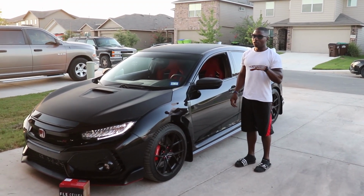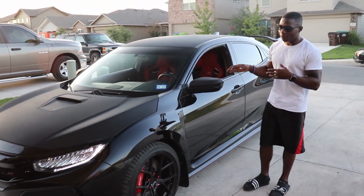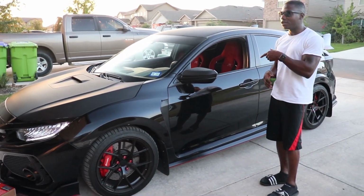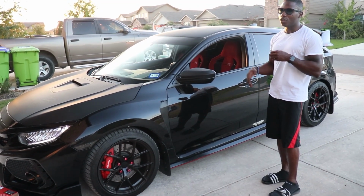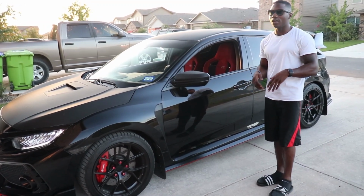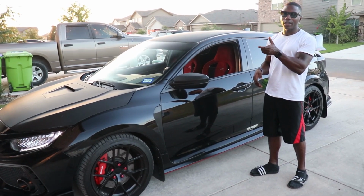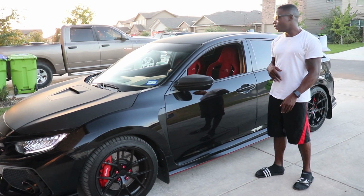Okay guys, we are done, like done. The last portion is we're just gonna throw in some E85, try to get a good mix and see how that works out. The one thing I'm gonna say is when you're done, you may get a couple of check engine lights. Those would eventually come off when you select the flex fuel tune, and then you have to go to the miscellaneous option under your calibration, and then just take a note of the sensors that are coming off, and then just check those boxes that are coming off, and that should get rid of all the check engine lights.